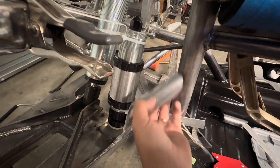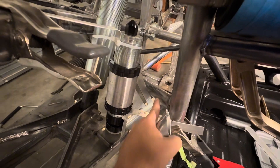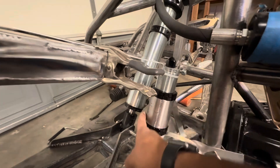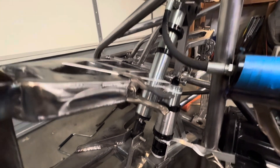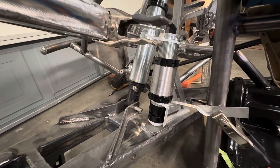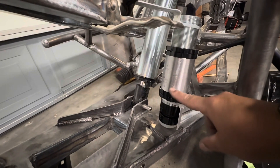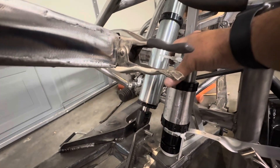After that I'll move on and start figuring out how I'm gonna do the rest of the tubes. I think I'm gonna run one more down at an angle and then one more into this inner support here. I can't do what Dug Bug did — he ran one tube from the other side up through here up to this top bar, which is actually a really good tube to have — but I'm not able to do that because these are two-and-a-half-inch stroke coilovers and he had four-inch strokes, so his were a little bit taller. His bump stop was a little bit higher up and he also had a bump stop can that was longer, so he was able to pick up his tube really high.